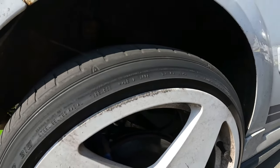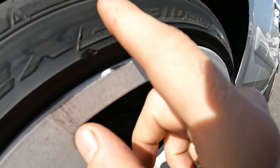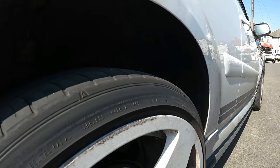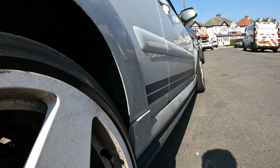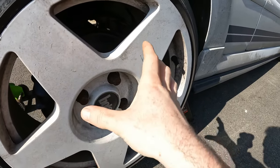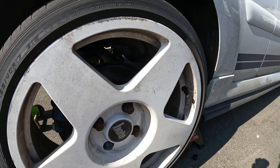What is happening everyone, we're back today with another video. Today we are going to be fitting some easy camber shims to the ST on the back. I've wanted to do this for a while because even after putting the stretch on, if you hit a hefty bump, you can see there's a wear line on the tire where the writing's faded — it catches ever so slightly. It's caused a bit of paint chipping there too, which I'll need to address otherwise it's going to rust up. I've also wanted the car to toe in a little as it gives it a more aggressive look. So we need to get these wheels off, get the brakes off, and then remove the hubs as if we're doing axle spacers, because the shims actually sit behind the spacers as well.